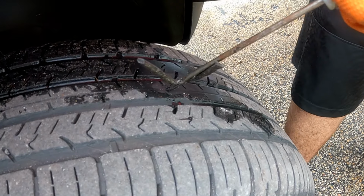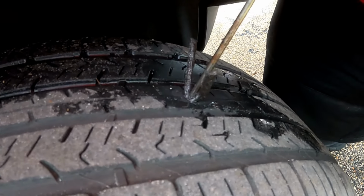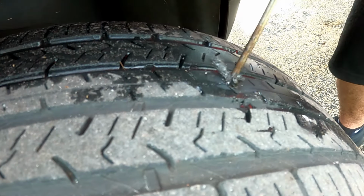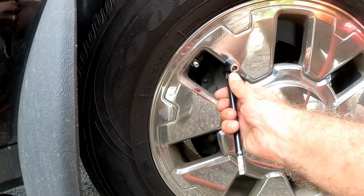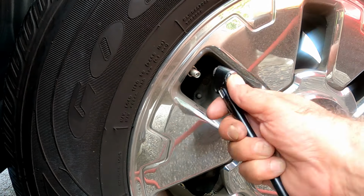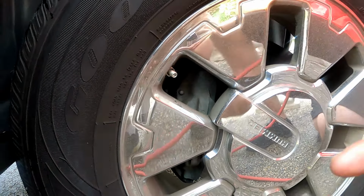If you don't have onboard air, you can hopefully get it from a friend or limp the vehicle to a service station. Remember to take it easy on the tire if the plug is in the sidewall or close to it. I put some information in the description regarding if a plug will be permanent or the tire should have a patch applied on the inside, or replace it altogether.